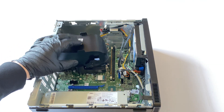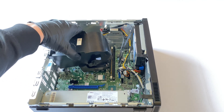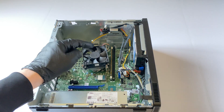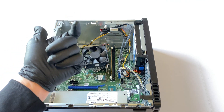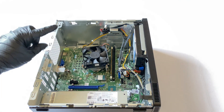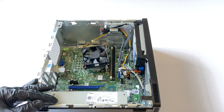What we have to do is remove the fan shroud here — the plastic piece. I will be adding a rear system fan. I also changed out the fan; the airflow is going that way, not this way. I'm going to remove this plastic fan shroud and install the 80mm fan for better airflow, because the video card requires it.